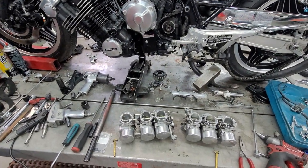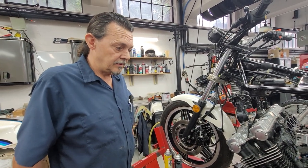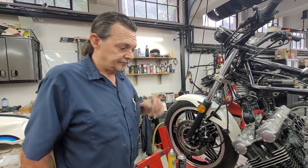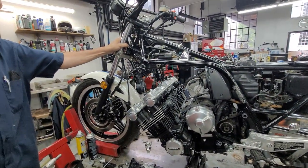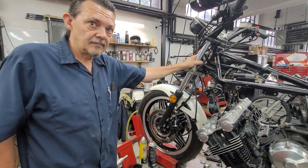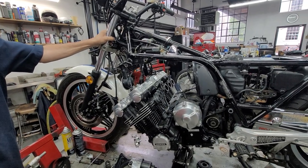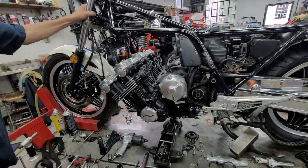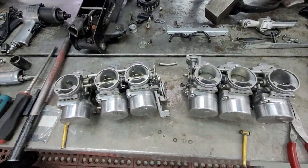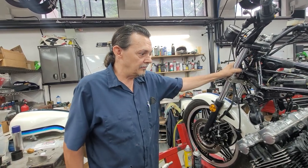What kind of parts list after this — is it just the O-rings? Yeah, it's just O-rings, but we stock all of them. So it's just labor. The problem with multi-carb units is you put them back together and they're not synchronized right — something that should have been a 15- to 20-hour job can often take much more if you have to do it twice. The linkage between all these carburetors is pretty intricate, and if you force stuff or bend stuff or assemble it incorrectly, it's not going to work right. You really need to know what you're doing. When I'm all done, it'll run like a Swiss watch.